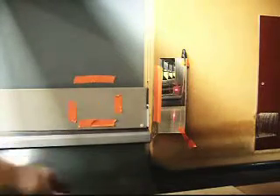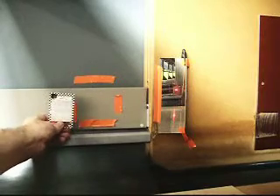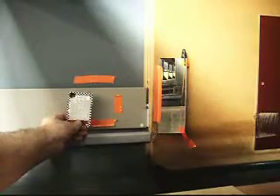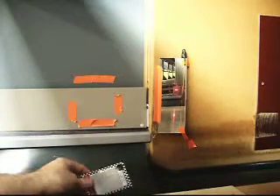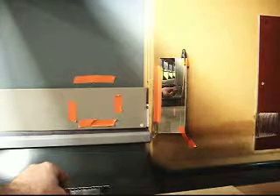I'll get you where you can see the photo cell red light indicator as well. So I've got the same old marks from before, from where it was. I'm going to take my card and slide it across. You can see it moved about half the distance — this whole square has moved over to this section right in here. So I'm going to do another half turn, so it's actually one whole turn, probably like I should have done in the first place.